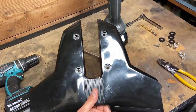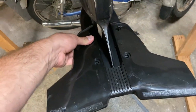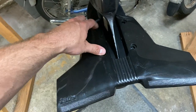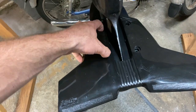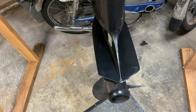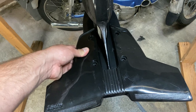Now we are going to mark the holes where they go on the lower unit of the outboard. We take this and put it on there. We want to make sure everything is centered, then stick a screwdriver or an awl down there and poke a little hole so we can see where it's all lined up. You do want this centered — you don't want it kinked off one way or another, so center as much as possible.